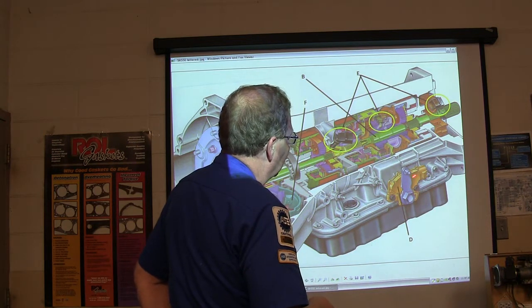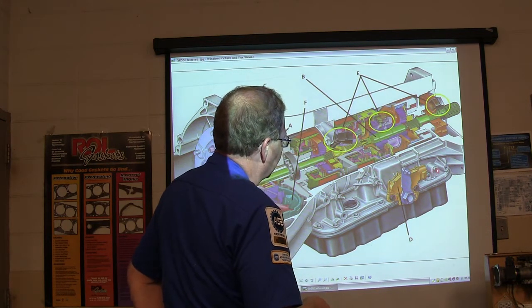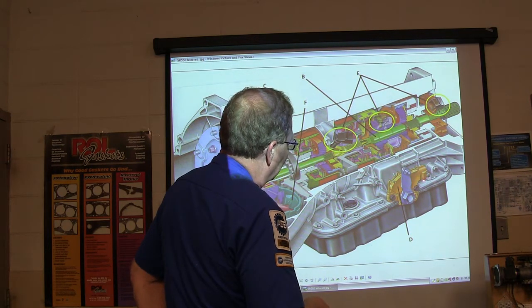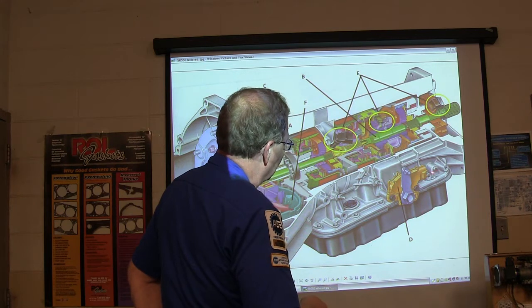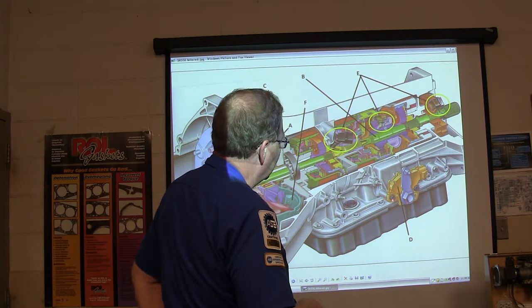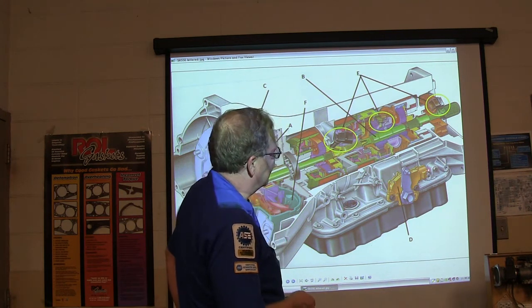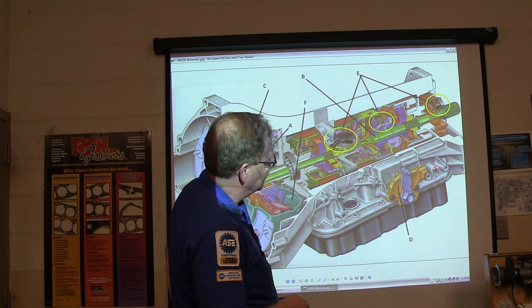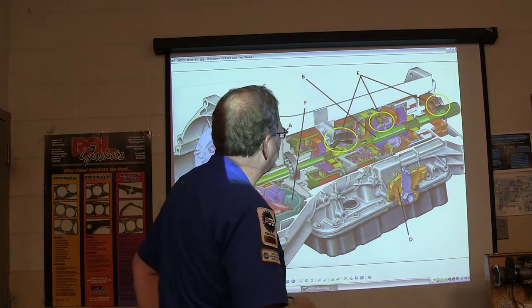You may also see band adjustments right here — one of those two bands. This is the port where you do your fluid checks. You've got to make sure when you're doing fluid pressure checks that you're at the right port, because some transmissions will have multiple ports.